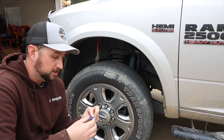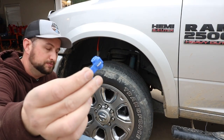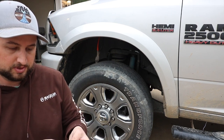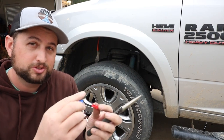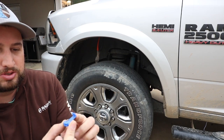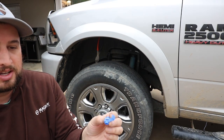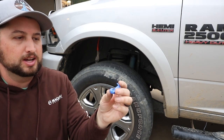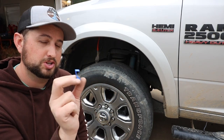I've got to reach up in there and get a hold of those wires. We've got these little wire splices — this allows you to splice a wire into the middle of an existing wire. The small wire from the lights goes into one side, you put it over the existing wire and clamp it down for the connection. My suggestion is: instead of using the door to close that metal piece, get your wires all in place, then use needle-nose pliers to push the metal part down, and then close the little door to cover it up.